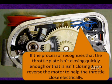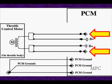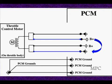We're going to start off with a fairly basic system: duty cycle the ground, but there's additional switching required. Here's one with two B-pluses and two sets of grounds. Predominantly we work with one of them — they're hooked up and we duty cycle the ground in order to set the throttle opening. But if we have a situation where the motor is stuck, we can reverse it and force it to close.